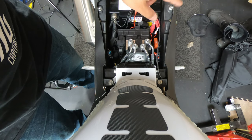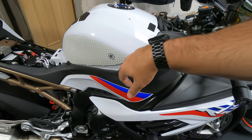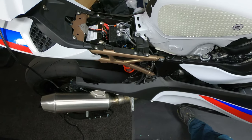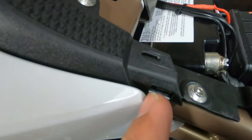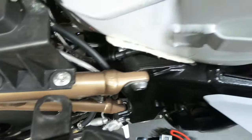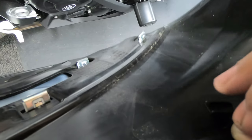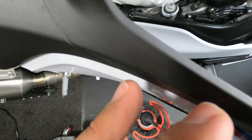Once you've removed the seat, you actually just need to take the two screws — one here, one here — that hold this on. These two aren't holding the side panel, they're holding the tray down. Once all the bolts are out, we're going to pop this off the top. There's a little catch here which you need to slide forward and the whole thing should slide forward. Do a couple of clips at a time and it should just pop off. There's a clip with a little tooth underneath that goes through that hole. There's a slide and another one just here on the tab on the tank — it sits behind this little hook on the back. So just be really careful, undo the screws, put it towards the front of the bike first, it will stretch it slightly, it will pop off and then you'll get the last two out.